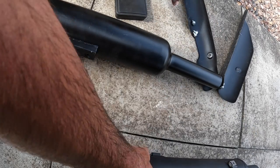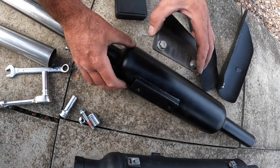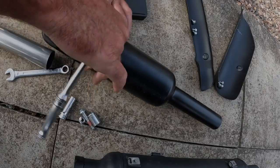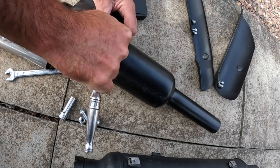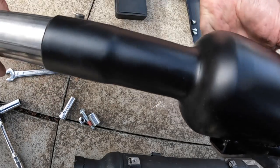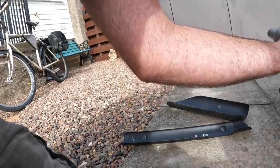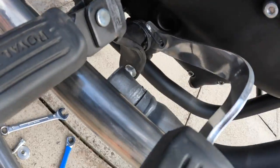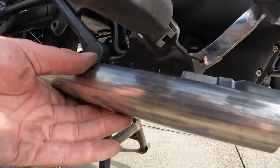If you get rid of that gasket it is actually 41mm, which is what fits into the Indian-made, 50-odd pound silencer that you can buy. I removed the standard rear silencer mount and bolted it on — and here you can see the 41mm pipe.